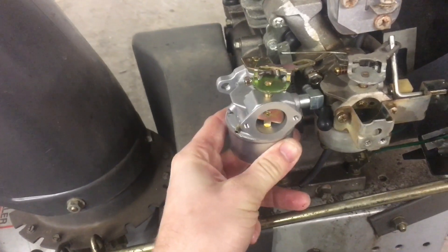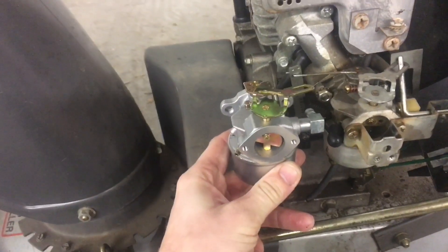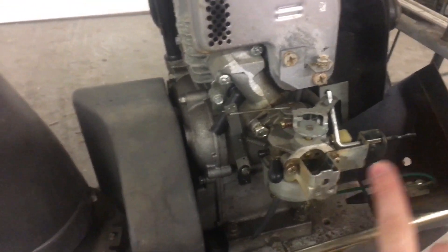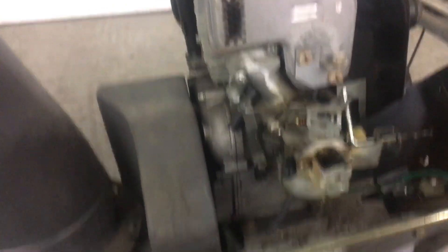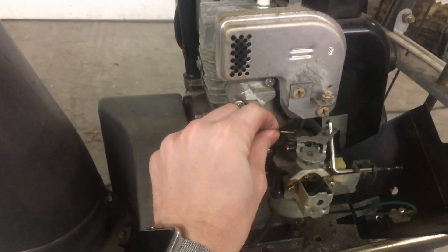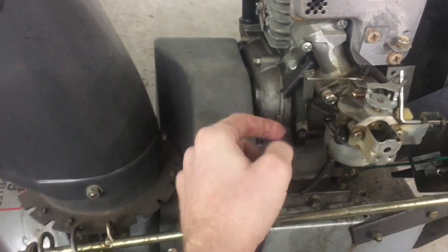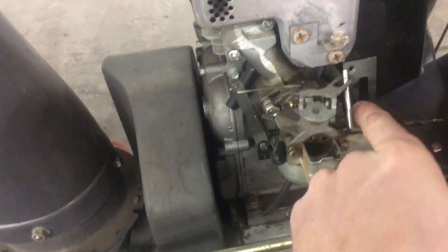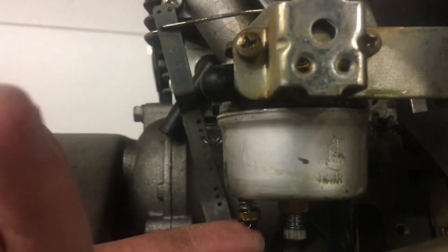There are actually more metal parts on the Chinese carburetor than on the original. What I'm going to do now is take off these two Phillips screws that hold the choke lever and transfer that over to the new carburetor, making sure the alignment is okay. Next up will be the governor linkage, then these two mounting nuts, and also the fuel line. Before you take out the fuel line, make sure the fuel is in the off position — on my blower that's horizontal.